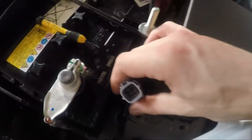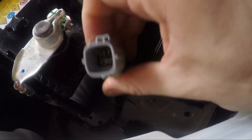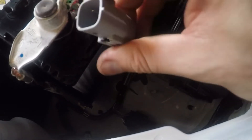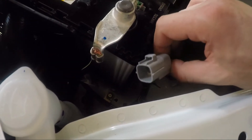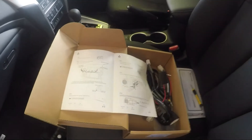You actually want this wire in the opposite corner to the wire that's already in there. The instructions say pink wire but mine is a red wire — opposite corner, so when you plug it in it matches with the green one down there. Now that it's in, I'll put the locking tab back in and plug it in. I'm going to leave the fuse out of this for now but attach it to the positive end.